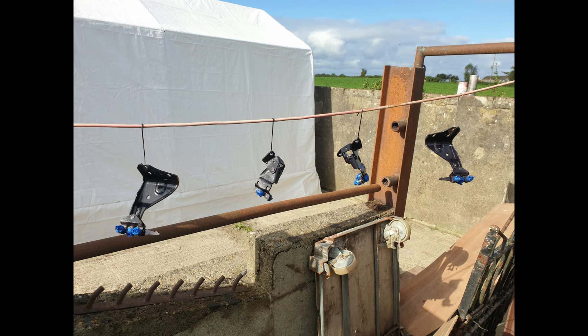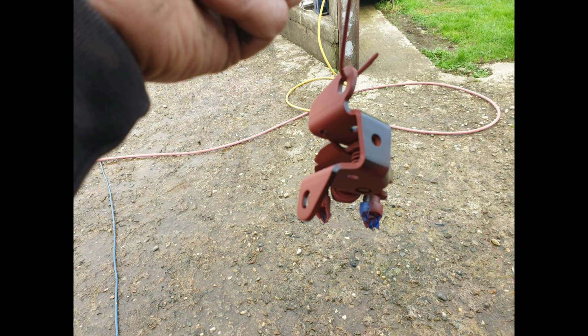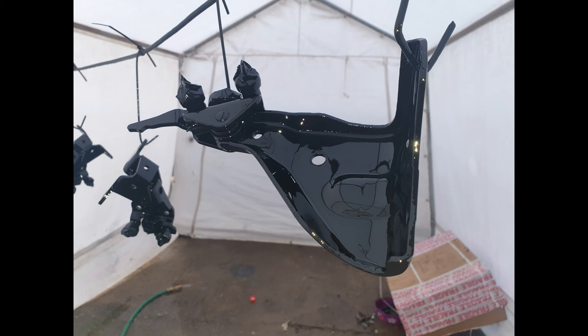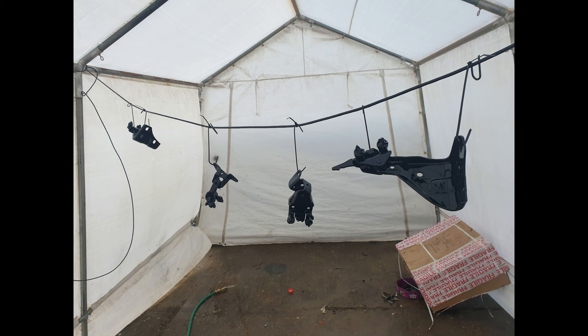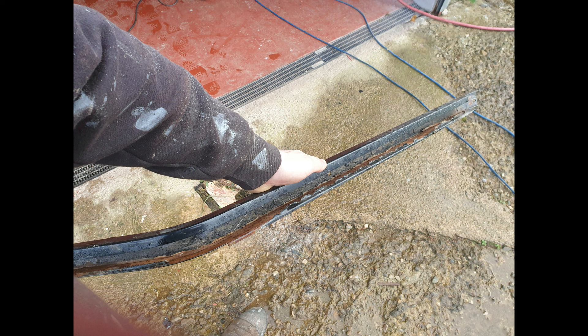This is the brackets up on the roller door in the middle of the door, and here they are finished after being sprayed in the tent and hung to dry — a nice black gloss. The paint I'm using is Vapormatic tractor paint if anybody wants to know. It's really good paint — it's like an enamel finish, much like the finish of powder coating. If you apply it properly you get a nice smooth finish with no haze.